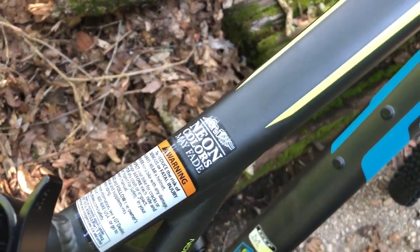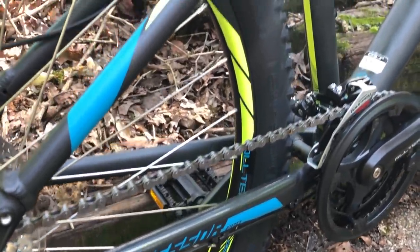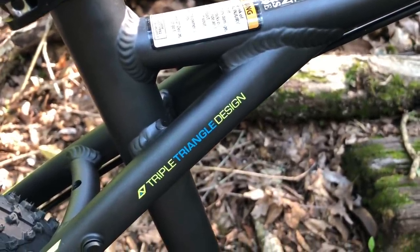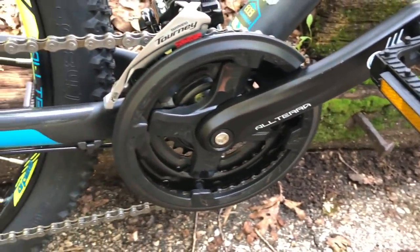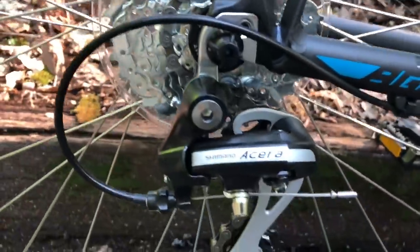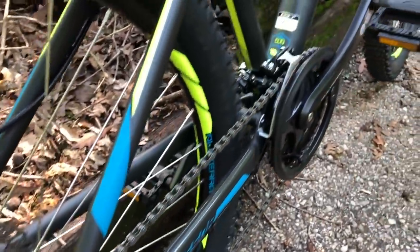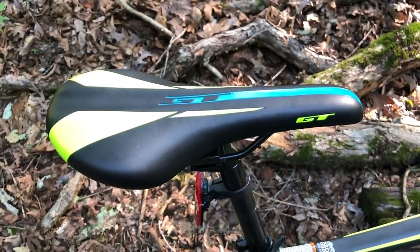There is a sticker letting you know those neon colors may fade. The most interesting thing about the frame is the design where the seat stay meets the seat tube — something they call a triple triangle design. The drivetrain starts with GT branded polymer pedals connected to Altera forged cranks. It's a 3x setup up front shifted with a Tourney derailleur, and in the back there's an 8-speed Sunrace 11-34 tooth cassette with a Shimano Acera derailleur — a similar setup to the Raleigh Tokul 1, which costs considerably more. You also get a quick-release seat post with a saddle trimmed out to match those neon accents.